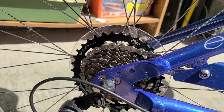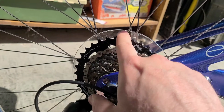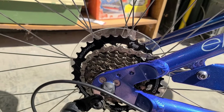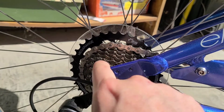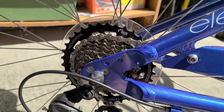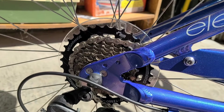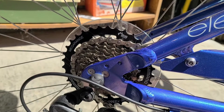But if your boat is correctly propped, then it's a lot easier, effectively, for your motor to pedal up here in this gear. It can spin freer, so your RPMs are going to be higher. Your screw might not be traveling through the water as far for that one revolution, but it's a lot less strain on your motor, just like it's a lot easier on your body to ride your bike up here than down here. So if you imagine that motor is running at cruising speeds for hundreds, maybe thousands of hours, and your RPMs are a little bit lower, you're really asking that motor to do a lot more work. And that's why it's so important that you not overprop your motor.